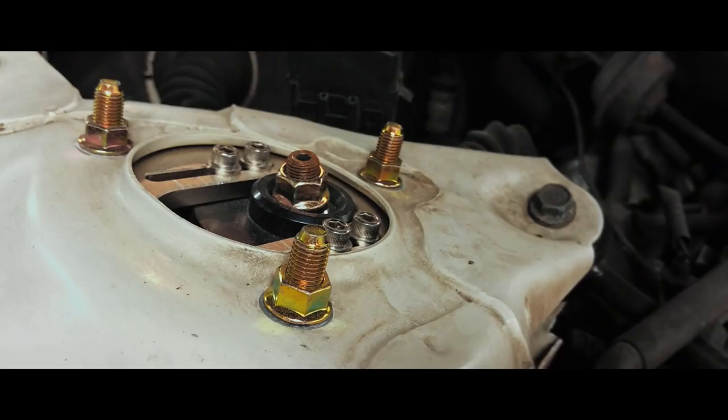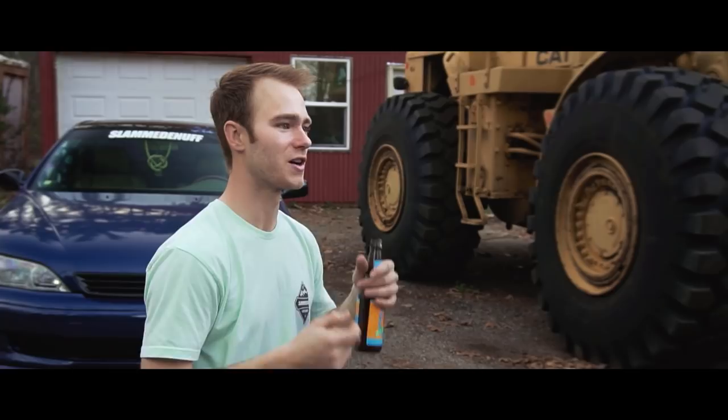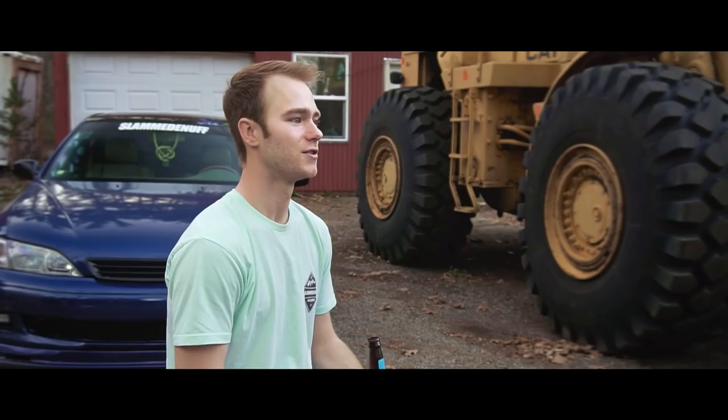With stance, there's kind of a bad rep, and you have to do a lot of unnecessary and sometimes kind of dangerous modifications to the car. Such as, I cut out my inner fender wells, like the metal, so I could slide up my wire harness so I wouldn't rub it. So there's a nice 12-inch spot of metal that has an inch taken out with no metal. That's probably not the safest. I do have some stainless steel plates welded underneath my subframe, so when I do bang, I hit those and not anything else.